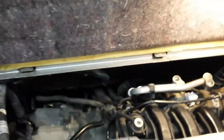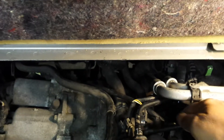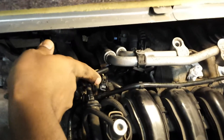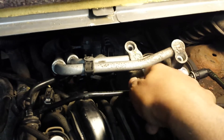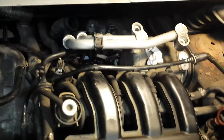This is the lead that comes from the battery — I can't pull it all the way out because it goes down and just has a connector in between, and that connects to the starter motor. The air conditioning pipes are sitting like this but they actually go underneath this pipe here — I just pushed them out of the way, which is why it looks like that. I also made sure that nothing ends up inside the compressor, so I took some clean pieces of cloth and plugged the two holes for the air conditioning compressor.